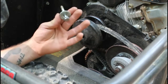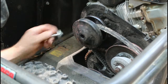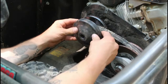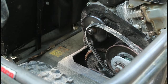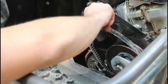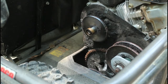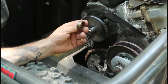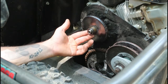The bolt pops out. You want to make sure that you keep the lock washer and the fender washer with it. I like to set everything out in the order I took it off. Then we're just going to slide it right off — again, keep everything just how it was — and then pull the belt out. That portion of it is complete. There is a little brass washer here, or really a bearing — you want to make sure that stays in place.